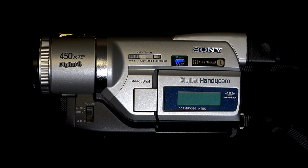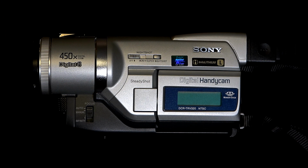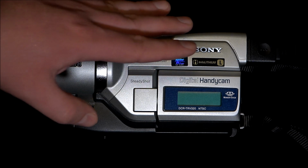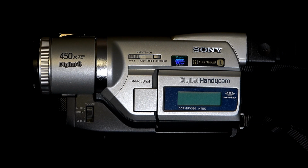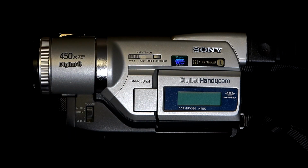Now, on a potentially more nefarious note, with rare exceptions, this unit bypasses Macrovision and stop copy and all that. The only time I've ever had this choke on me is trying to record a Macrovision-encoded program onto 8mm tape. And the only reason I was doing that was I was reading all this stuff about copy protection in the manual, and I was thinking, I've never had that problem. And I realized that it probably only engages when it's in record mode. And sure enough. But of course, given that the end game for me is usually to transfer video onto the computer, so we're talking video source to camcorder to computer, in this case via FireWire, as far as the camcorder is concerned, it isn't recording, so it just passes along the signal.